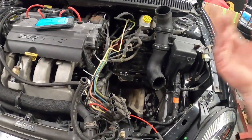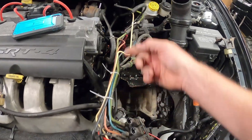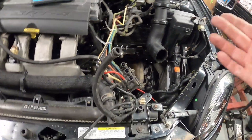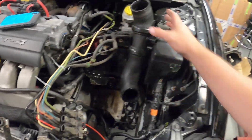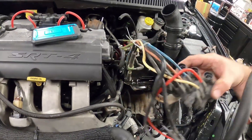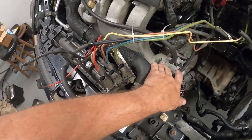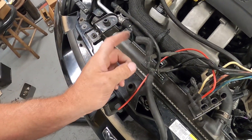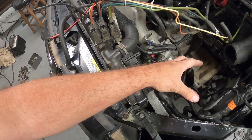The vacuum and boost changes signal the surge valve to open and that's where you get the sound. If you install an aftermarket blow-off valve, you delete the surge valve with a block-off plate — a small square or triangle block-off plate — and put a hard pipe in. You no longer need the blue solenoid; they call it a 'blue line delete.' This car already has it done. The BOV feeds off of vacuum directly here.